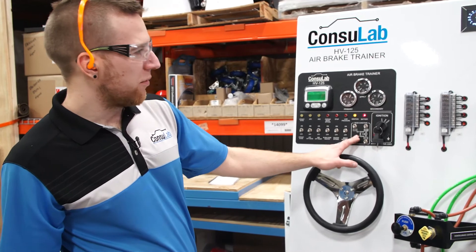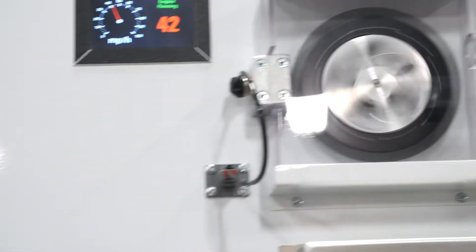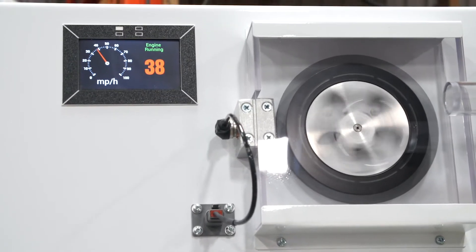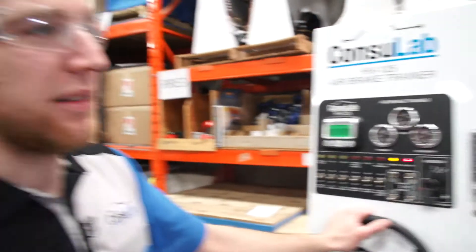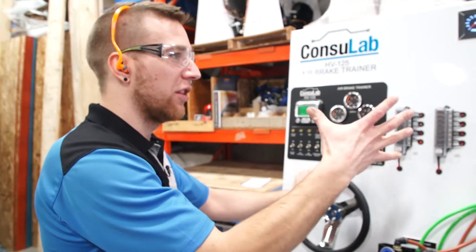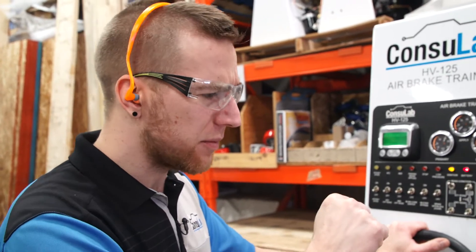Next we've got our choice of road conditions. Right now we're just driving down the road — everything's fine. I'm going to turn this right front wheel to ice, and we're at 40 miles an hour. If I start braking lightly, nothing happens. If I brake hard, all of a sudden that wheel locks up and we can see the ABS engage. The ABS system applied the brake, saw that the wheel locked up, disengaged the brake while the other three wheels were still braking because they were not on ice, and it's able to modulate and throttle that brake to keep the wheel from locking up so we can maintain control of the vehicle.